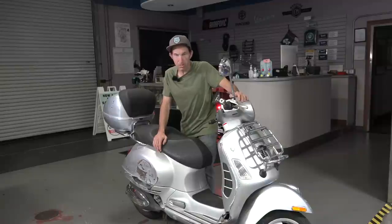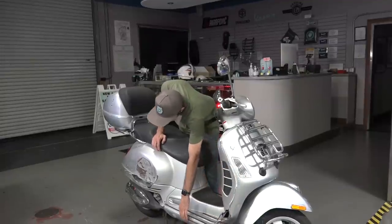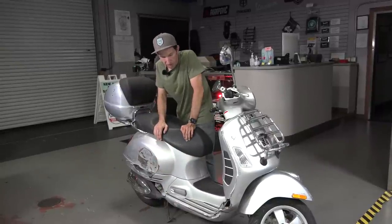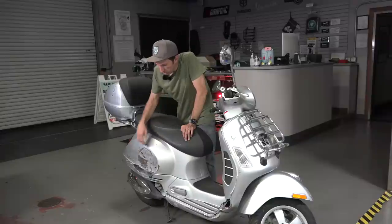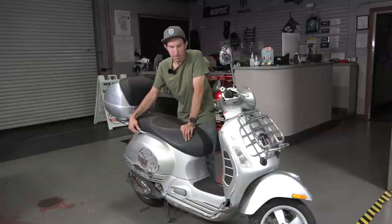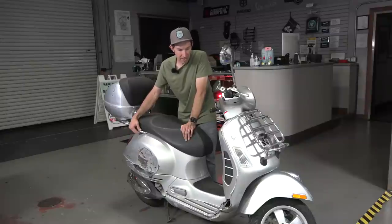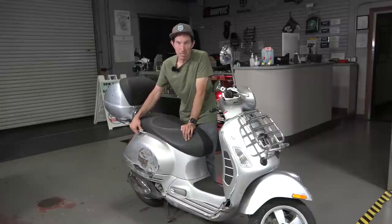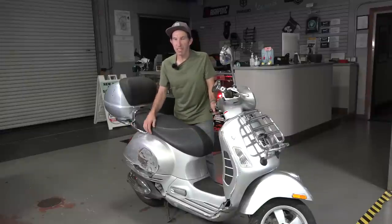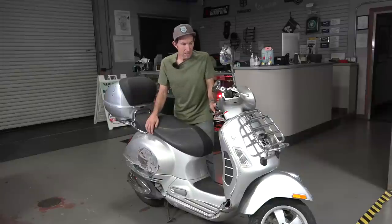He's restored vintage Vespas that look worse than this — just hammer and dolly work on the sheet metal. On a Vespa all this is sheet metal. There are lots of tricks of the trade: hammer and dolly, slide-hammer rivets to pull dents close to the original shape, skim coat it, prime it, and respray it. I do not want to build a custom like my robot bike — I want something that if it falls over I'm not crying about it. This sparked my interest after riding my Pacifico bike. I have several videos from about six or seven years ago; that bike's still down in Mexico.